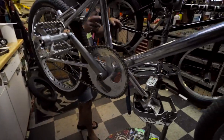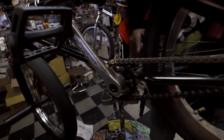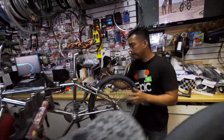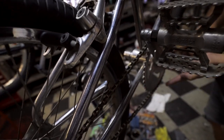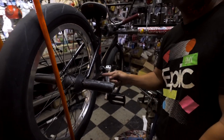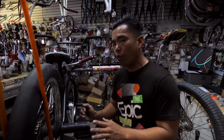But the sprocket won't work interchangeably. If you notice, this sprocket is on the right side and Max's bike has it on the left — but that's not why it won't fit. What makes it not fit is this little chain stay bend right here. This old frame was designed for a smaller gearing, so the chain stay bends close. The new frame doesn't have that bend. If you put this big sprocket on the old frame, it would hit the chain stay teeth. With some modifications here and there it might work, but generally it won't.